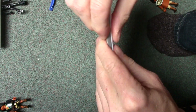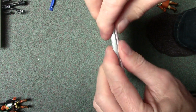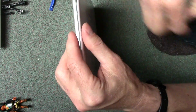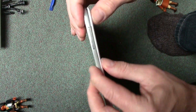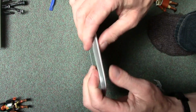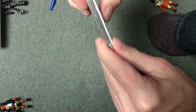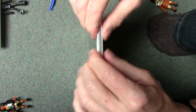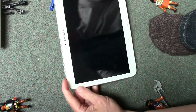You'll find when you do the first pass it won't click everything. If anything's resisting, take the cover off again, like say if that was resisting, closing, pull it all off again, start again, because you shouldn't need to put a lot of force into this, and if you are, it's not aligned properly and you'll end up breaking or bending tabs. Second pass, things are still clicking into place. Right, that's about it. Then obviously the test is to switch the thing on.